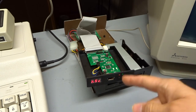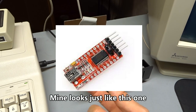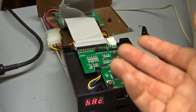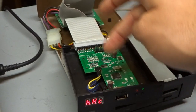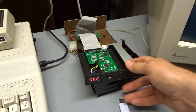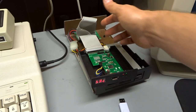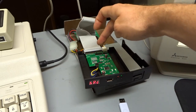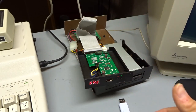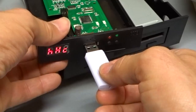I'm not going to show you how to flash this. The way it works is you use a USB to 3.3 volt TTL serial UART converter — very cheap from eBay. You use his online software, put the device into bootloader mode by changing a couple of jumpers, and it will re-flash. Then you stick the thumb drive in and it loads the firmware off that. I currently have this connected in my external enclosure as the B drive on the Tandy. You can also change the DS0 jumper to install it internally.